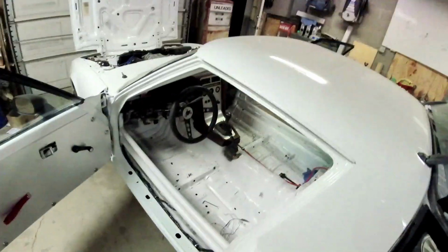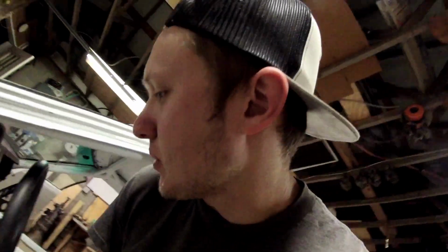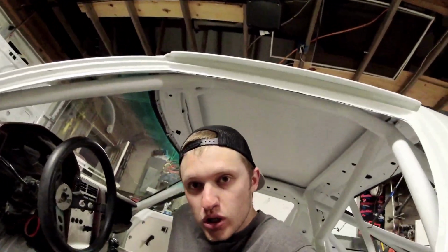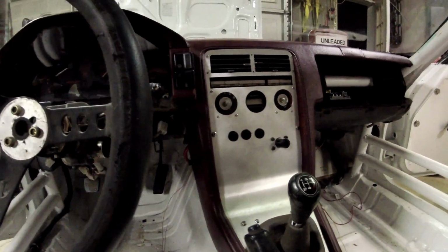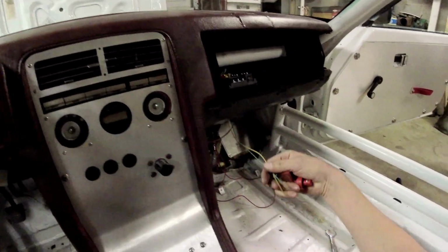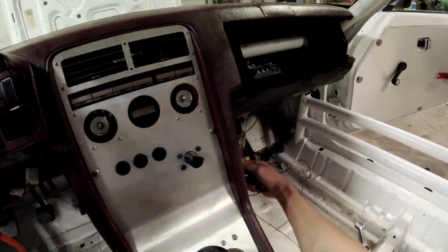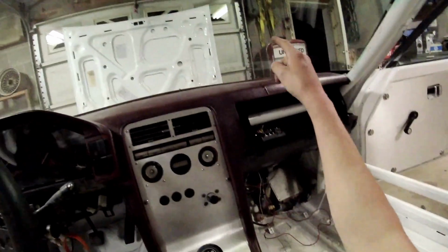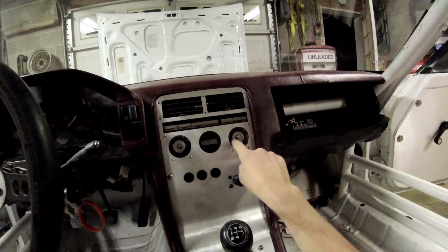Alright, my dudes, look at this unit. So, I got a bunch of this stuff cleaned up. We are fixing to send power to this rig right now. So, fuse block's all wired in. These are my two extra leads, one for the front lights, one for whatever else I want to do. I still need to extend the wire for my front LED service light and put these little nuts on.